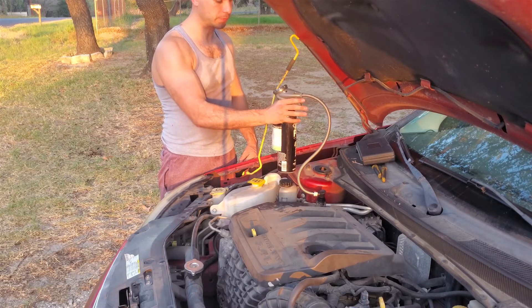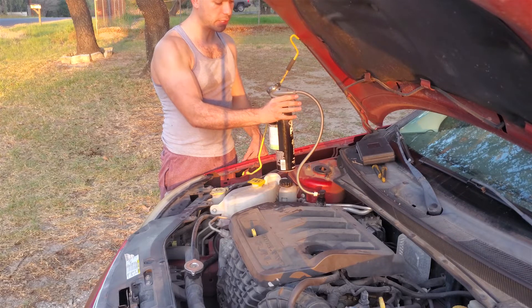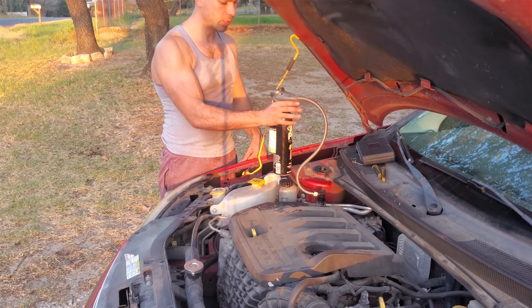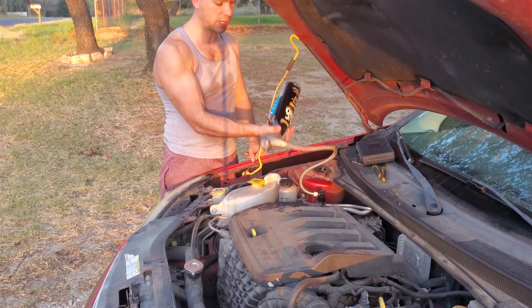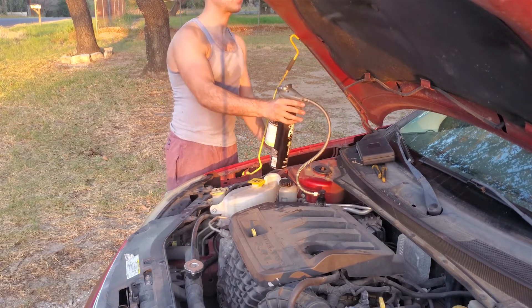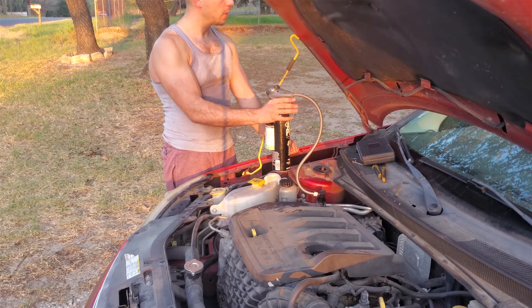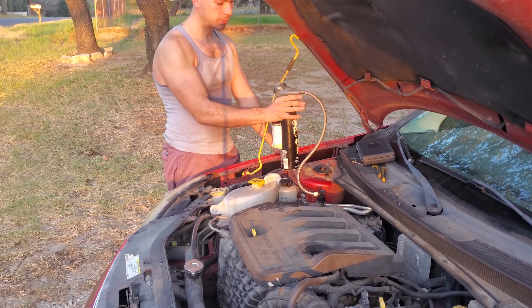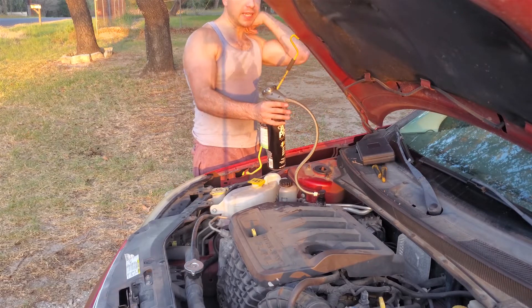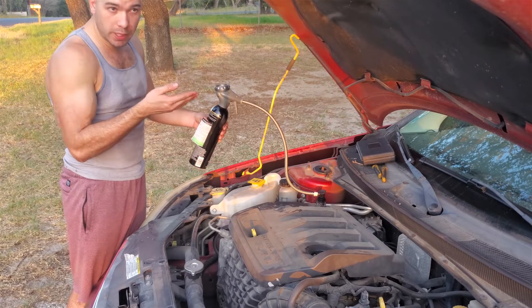She's already coming back up pretty quick. My AC is on full blast with recirculate on. You should always charge your AC with the AC running — that way the compressor is pulling a suction on it, so you're not just filling a dead end. We're almost at 30 psi now. I like to shoot for about 35-40 psi on my low pressure side, and I'll do a soap bubble test once I'm all done.